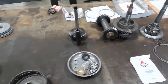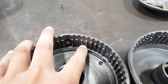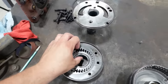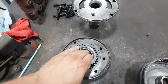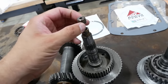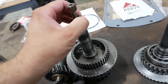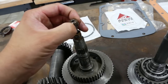I've cleaned everything, I've checked everything. We've got a little bit of wear on this clutch basket — the splines here are a little chewed up where that one clutch plate was broken. It doesn't catch; I think it'll be just fine. I pulled the pump apart — it looks really good, there's no grooves worn or anything like that. It would be best to replace it, but it looks pretty good, so we're going to reuse it. I got a new seal for it. The only part I'm not sure about is these split rings — they seal the inside of the pistons. The outside is sealed with rubber o-rings, but they're very expensive, like $40 a piece and there's six or eight of them. They look fine to me, so we're going to reuse them.